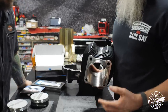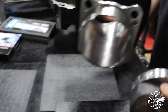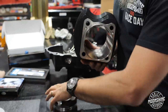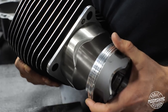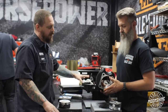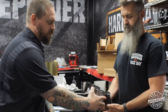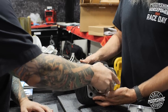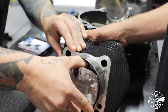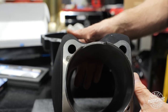If you notice on the bottom of our spigots, we have a couple of notches — the first is a notch to go around the oil squirter, on the same side as the pin. When the piston is all the way down the bore, your skirt is front and rear in the cylinder. Some other supply companies are making large bore that you can fit into a stock case, but I'm fairly leery because most of the pressure on the piston is at the bottom when it's switching thrust surfaces. There's not a whole lot of width down there, and when this piston comes out just a little bit it'll rock. The thickness of this spigot, to me, is vital to longevity of the engine.